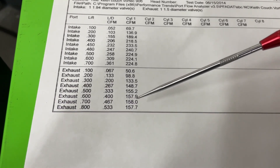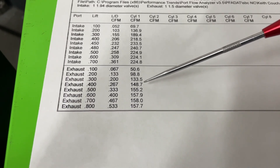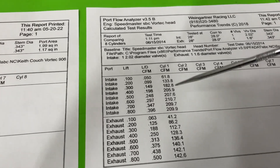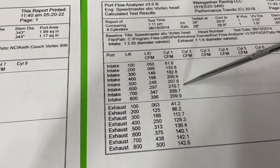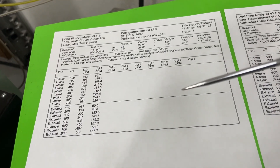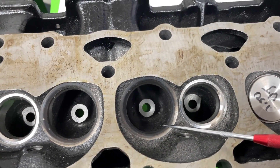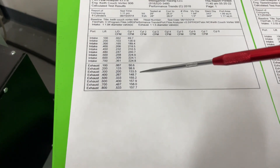The exhaust flow is pretty good at 158. Is it outstanding? No, because really even at .400 it's only 150, which honestly for a small-block Chevy is pretty weak. But compared to other stock heads, this is pretty good — remember, no port work done. So this is that Speedmaster head. If you compare it, it only peaked at 211 on intake and 143 on exhaust. So the stock one with just a valve job done to it is way better than that. I will get to do a valve job eventually on these — the guy is supposed to send me the other head so I can do it, and you get to see what improvements can be made. I don't know that it's going to match this though, so we'll have a good comparison.